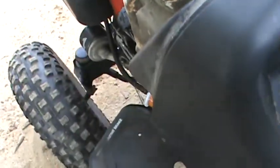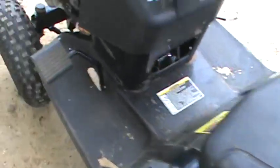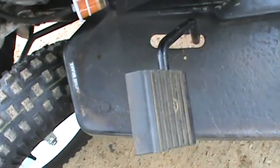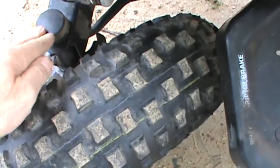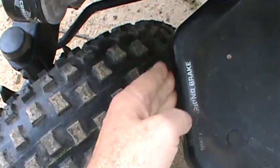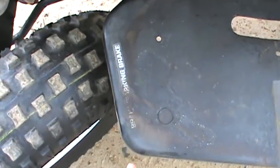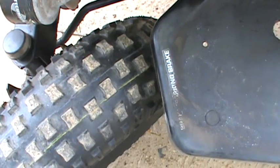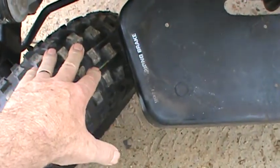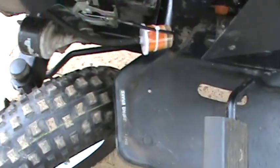Still a work in progress as it goes. These right here — turn that wheel — as you can see these things have really short turning radiuses, so I have to make a few mods here. If the axle flexes, which I am going to leave that flex in there, it hits here and the knobs catch up under this brace. So what I'm going to do is cut this piece on both sides straight across and put a piece of angle iron there, facing up instead of down, so it still gets the bracing. If the knobs do come close to hitting it while the wheel is turned, it's going to slide rather than grab and peel off my tread.